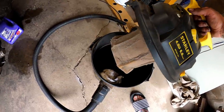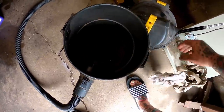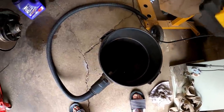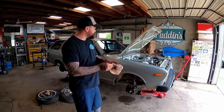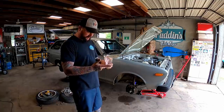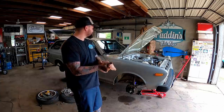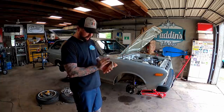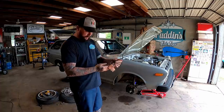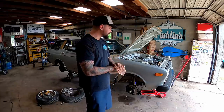Looks like that did good on that master cylinder. And then look what I did. I zip tied a rag in there, that way it wouldn't make a huge freaking mess, and that worked too. I think we're gonna be good on the old master cylinder, hopefully. And I think those little drop-in filters may have kind of saved us. That's where all the crap was. So, everything cleaned up pretty good. Get this nasty crap off my hands. I did spray down those filters before I dropped them back in. They cleaned up, looked brand new too. So, wipe my hands down. This is the same wipe from yesterday. It's still wet. It cleans just as good. I'm just playing.